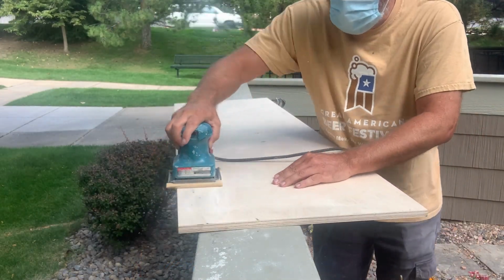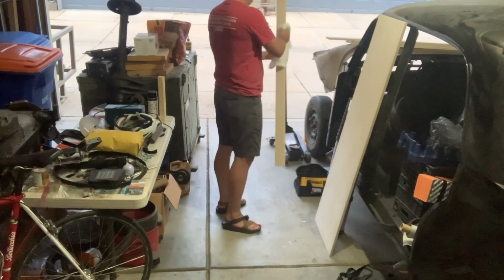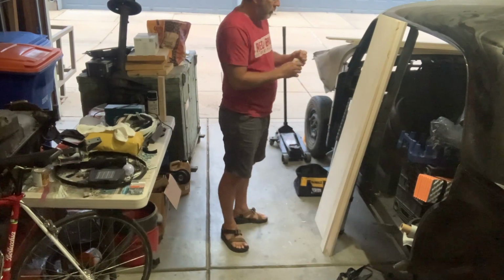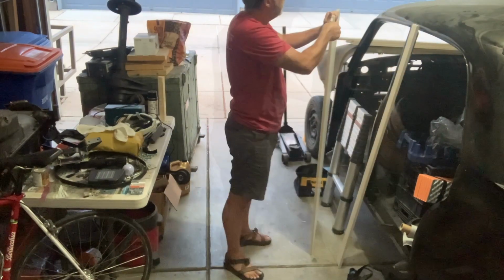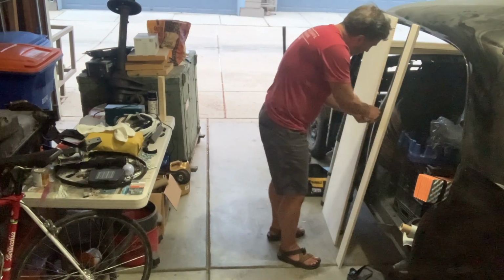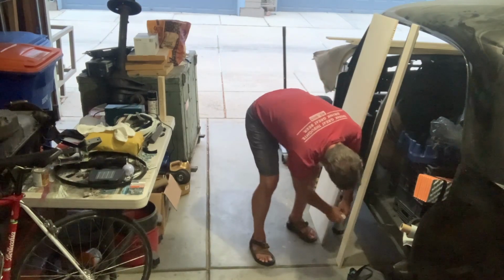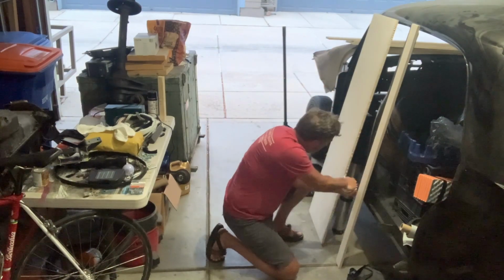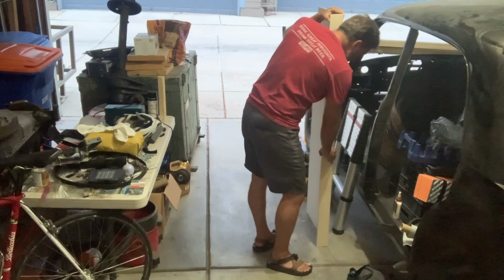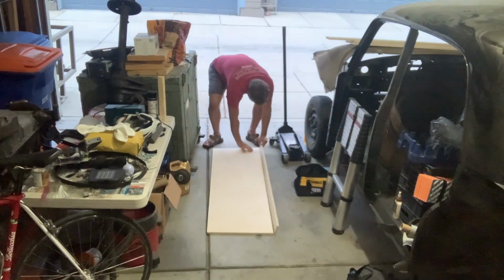After picking up the sheet of 5/8 Baltic birch ply and getting it cut, first thing to do was to sand all the surfaces. I used a cloth to brush off the remaining sawdust, and then a bottle of Gorilla Glue on the common surfaces, and then clamp everything down and let it dry for a good while.